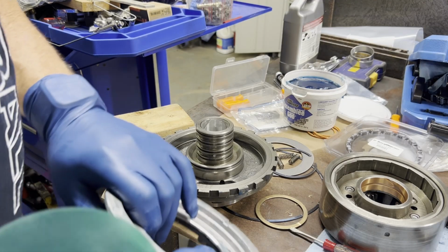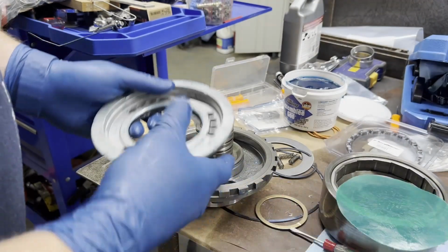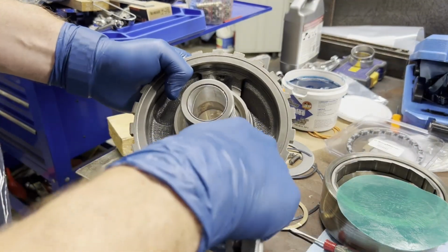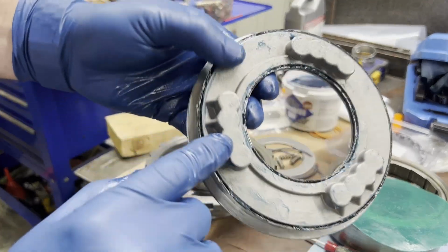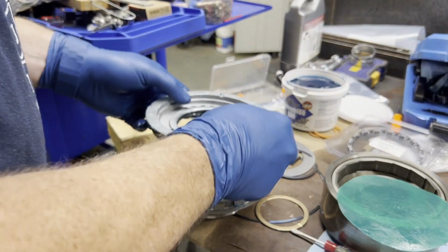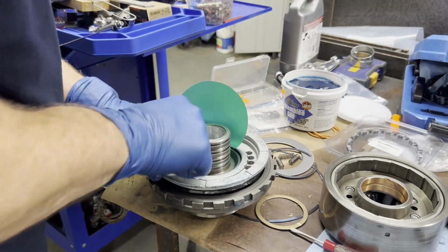Okay, we're going to try this with the lip wizard. It's going to be kind of hard to get that one started, but notice the pockets inside of your center support. And you've got these three notches. They're going to line up, so we will get our center seal put in.